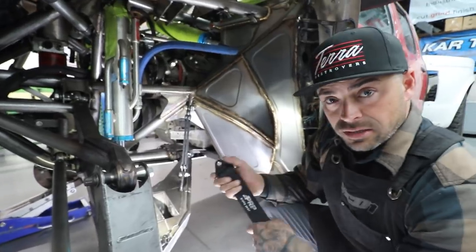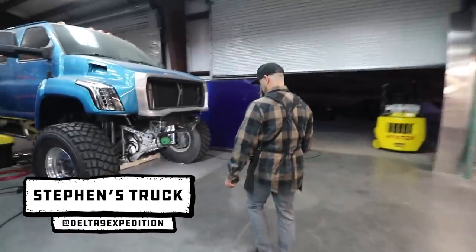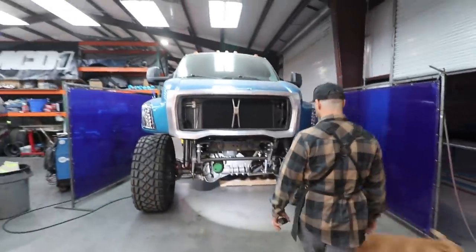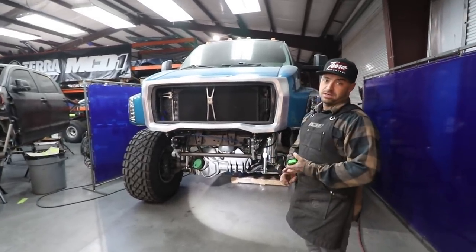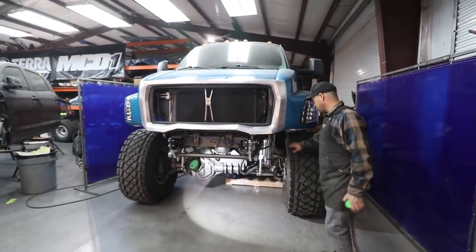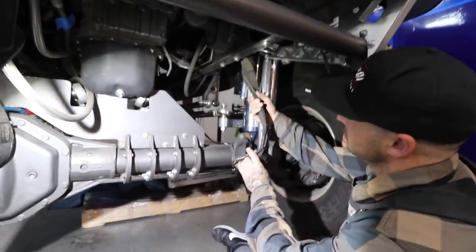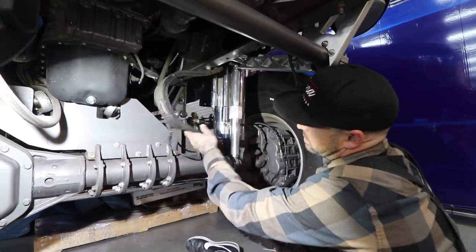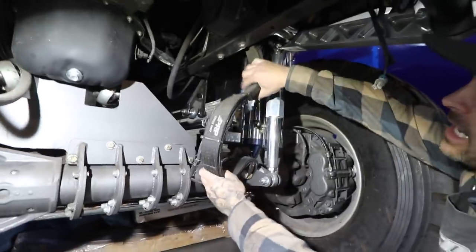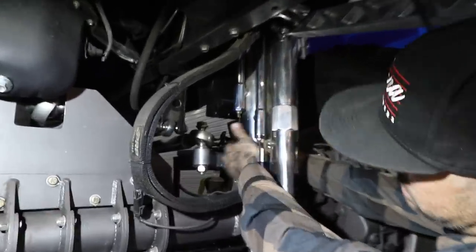We're going to check out the rear setup of a truck. So this is a client's truck, rather large in proportion. This thing's got big axles, it's on airbags, it's got a bypass, it's got sway bars, and it's got a real large tire and wheel setup. He is running straps — you can see this thing's sitting fully compressed right now. There's a big strap here, zip tied so they don't spread apart. This is the maximum amount of travel he has. When this thing droops out, these things are going to get really tight and save this whole shock package, which is a four inch shock.